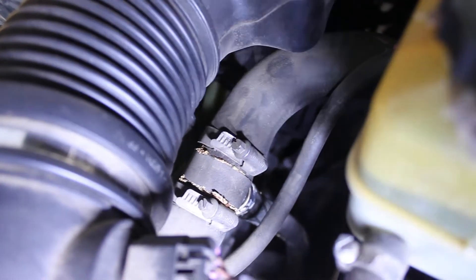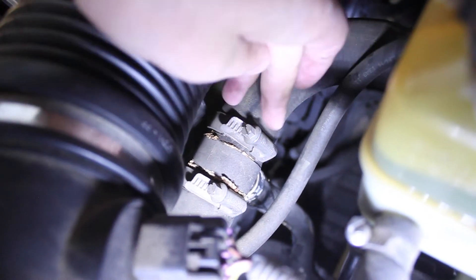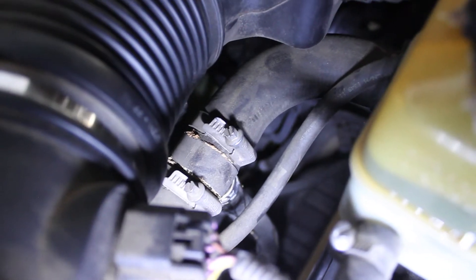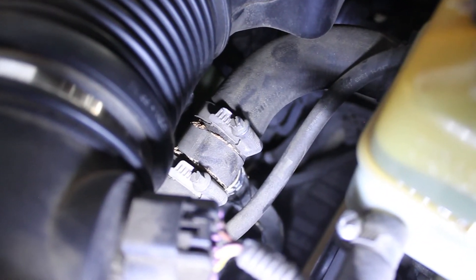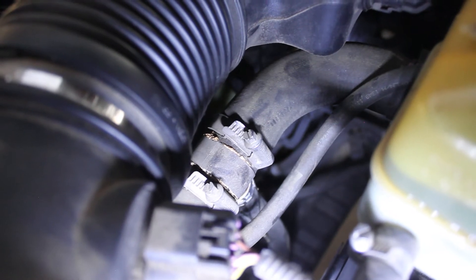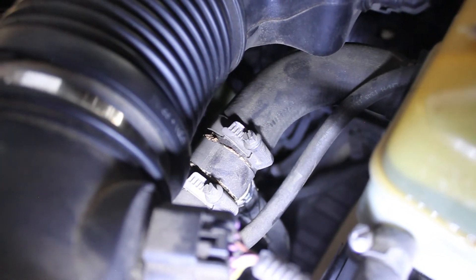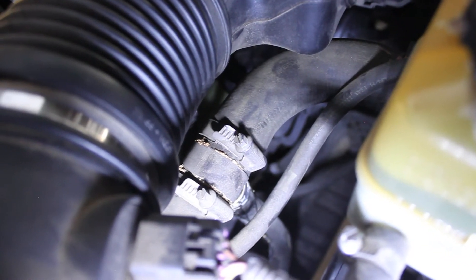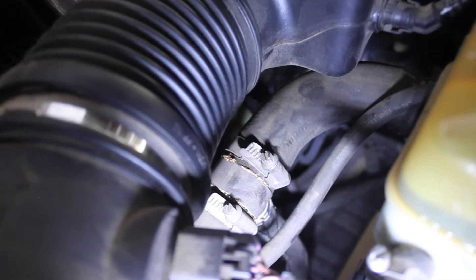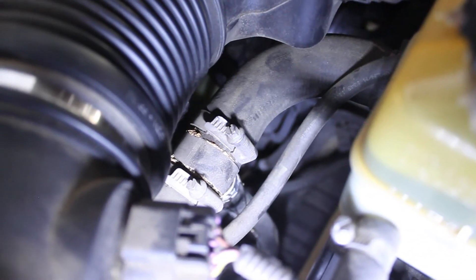This is what the Improved Racing oil cooler delete kit is for. This is the upper radiator hose and it has a fitting in it with a line that goes down to the factory oil cooler. The factory oil cooler uses 200-plus degree coolant running through the engine to cool the oil, and that doesn't work very well. On the track we were regularly seeing over 200 degrees — sometimes upwards of 220 or 230 — and that's kind of borderline overheating. So we're going to change out this hose; the return goes into the side of the block, which is what this big brass plug is for. We'll get the intake off and start pulling these coolant lines.